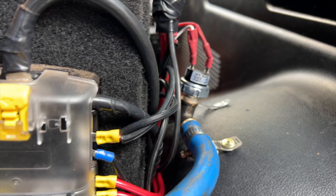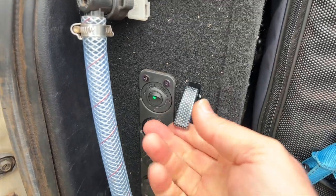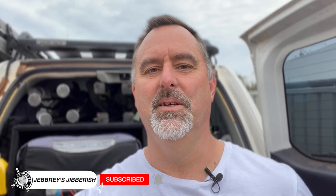I hooked the air compressor up to two 25 amp fuses — I should have put two 30s in because it's got a 60 amp rating, but I didn't have any 30 amps left, so I'll worry about that when it blows out in the bush. I've run it straight to the relay, and the relay is switched via a pressure sensor — a 90-on, 120-off pressure switch I got off eBay. That runs through a T-piece to a missile-style switch at the back. I went with the missile switch so it doesn't accidentally get knocked on while driving or by someone not knowing what it is.